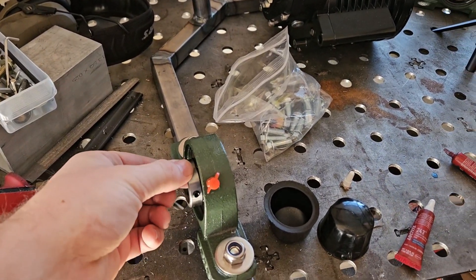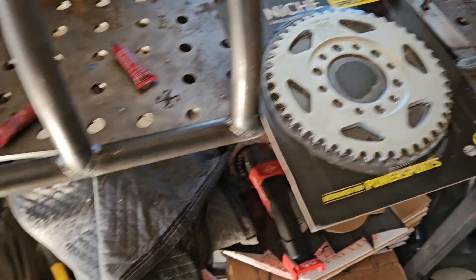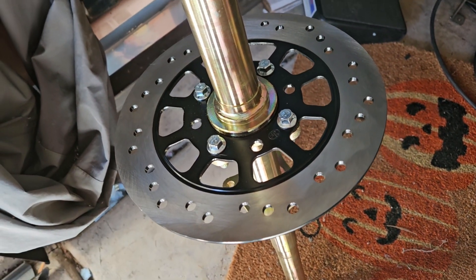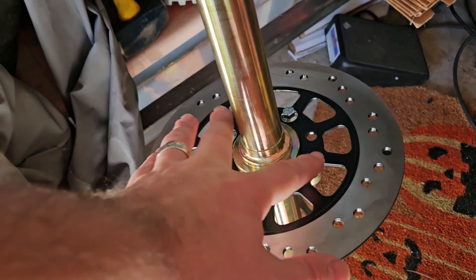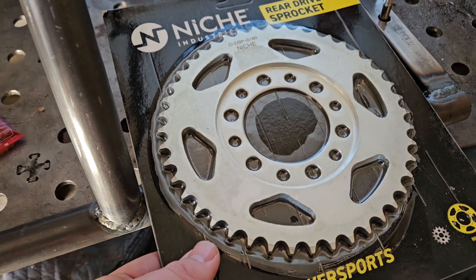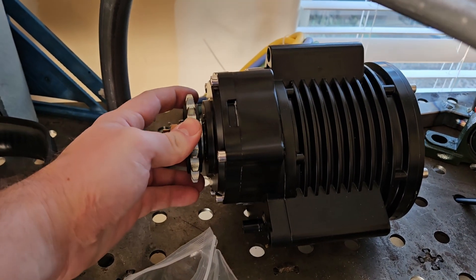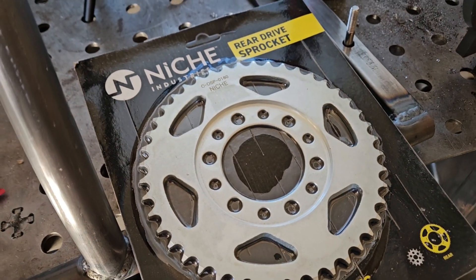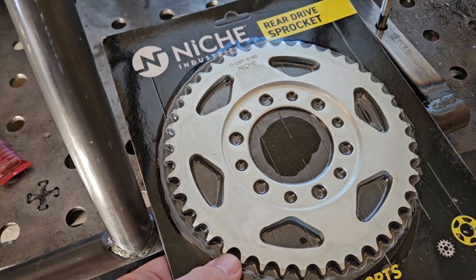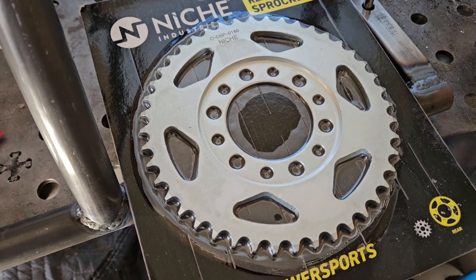I got some of the rear components for the rear drivetrain — there's a couple of carrier bearings that go on either side of the axle, and there's the axle with the brake rotor. The rear axle comes with a rear sprocket but it's a 520 sprocket. A lot of these electric motors use a 428 chain sprocket, so I had to find a 428 rear chain sprocket with 80 millimeter spacing. We'll see if this one works — we'll probably order a smaller one, but from what I can tell this is probably going to be big enough.